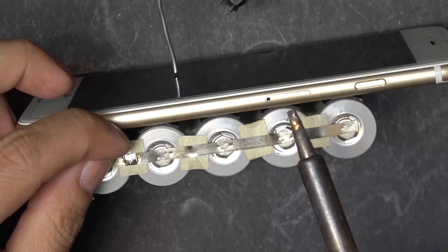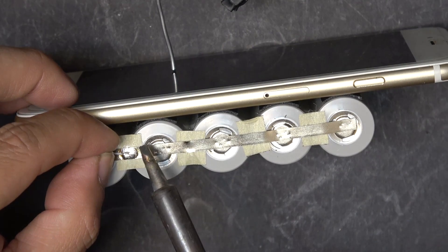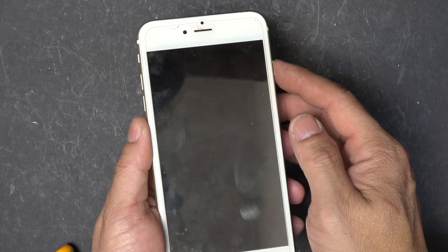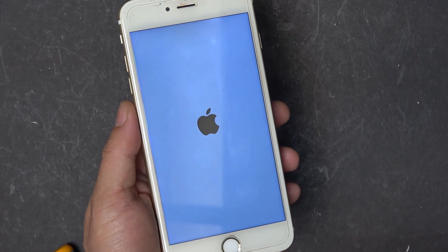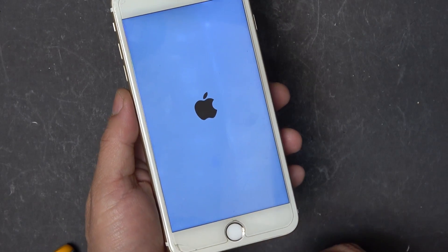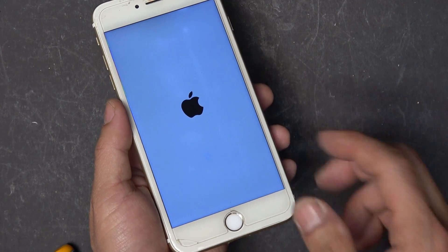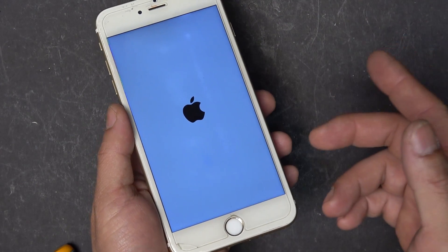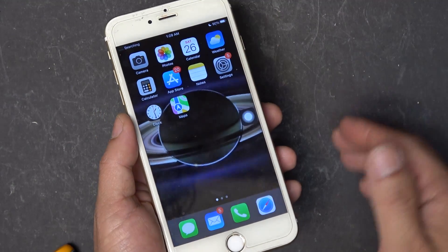Next step is to solder the wire to the battery. Just like that — the wires are soldered on and it's ready to go. Moment of truth — see if it turns on. Boom! Well actually, I had to plug it in first and turn it on first, because the moment I unplug the battery, the phone doesn't turn on when I reconnect the battery. So I have to plug it in, turn it on, then turn it off, unplug it — and now if I just press power, it will turn on just like that.